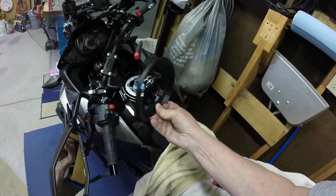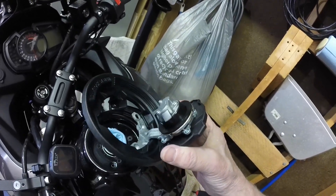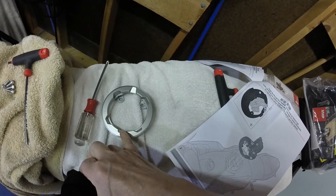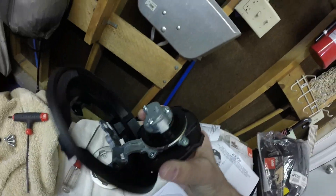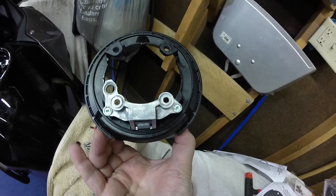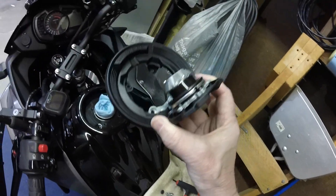As an intermediate step, I've got the BF29. You have to take the filler unit off of the original tank and off the original ring. This is the original plastic ring — the BF29 takes its place. You attach this on with two little Phillips — actually they're going to be JIS, Japanese screwdrivers. It looks like a Phillips but it's not; you can't use Phillips, you've got to use JIS. Then you attach the filler cap to this new ring.